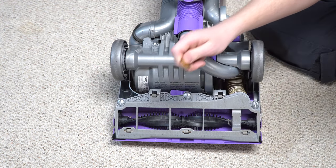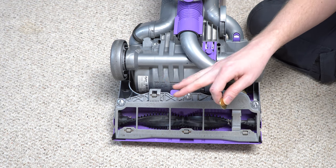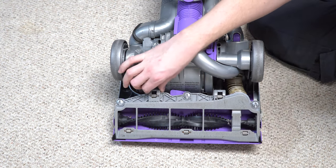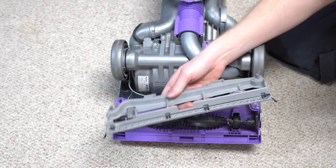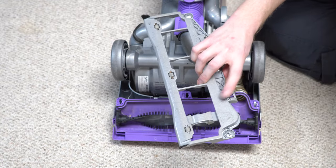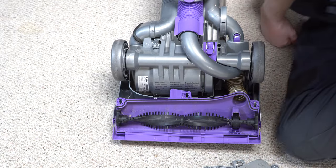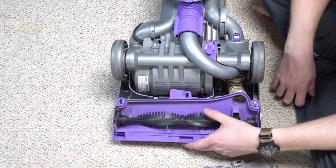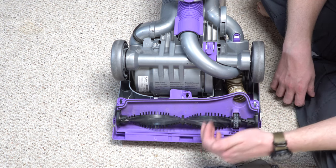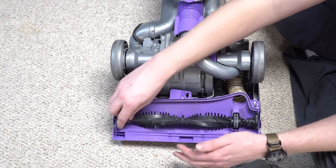You can take a coin — do not use a screwdriver. Always use a coin, or you need a number six or larger screwdriver. This pops up out like that, and you'll see there's a seal there. These little wheels would get ground off and lost — they were actually replaceable by themselves for a while. You can see how scratched up this base plate is. The brush roller has not very many bristles on it, and the aftermarket replacement brush rollers were really bad — known for cracking and having fewer bristles, which would worsen performance.